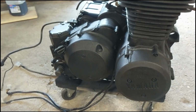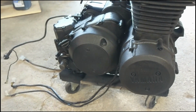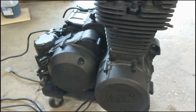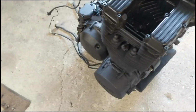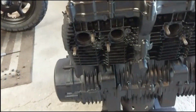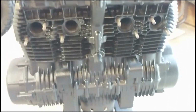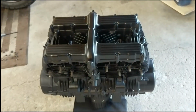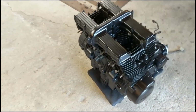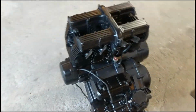I don't know if I said it earlier, but I'll be traveling to Europe for the next 2 or 3 weeks, so I probably won't do a video for another month or so. So this is going to sit in this garage and let the paint really gas out and cure, and then it'll be a while before it runs anyway, until I get everything reinstalled on the bike. But this is how VHT engine enamel turns out on a bike when you finish painting it. Really happy with how it turned out, and excited to move on with the project and put it back in the bike.